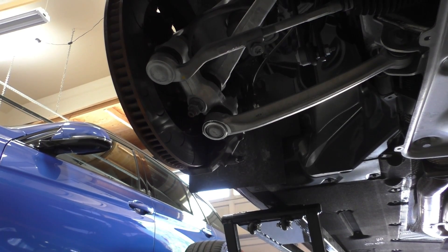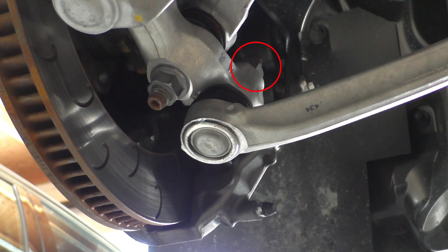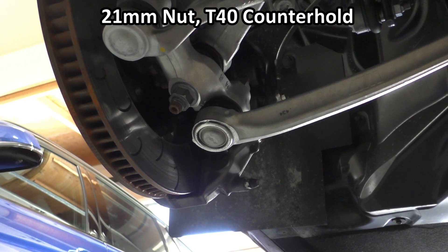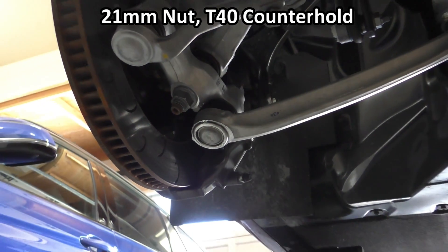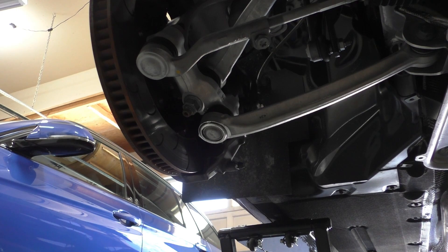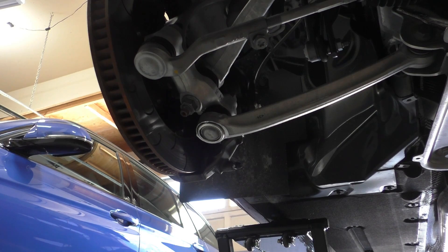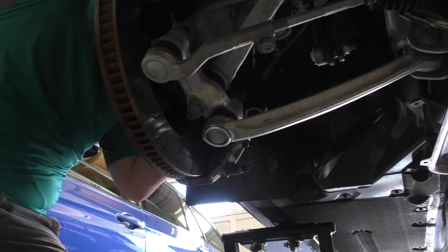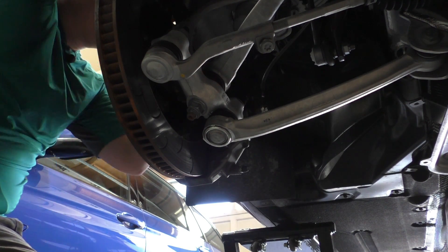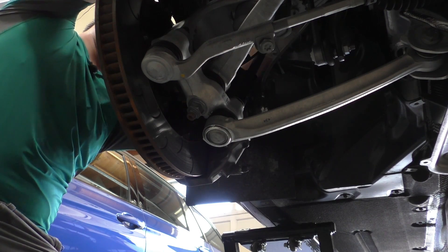Next I want to take off the nut that holds the wishbone or lower control arm to the knuckle. This is a 21mm nut on top, and the post of the ball joint has a T40 counter hold in case you need it. In my experience I've been able to just use an impact and spin the thing off all the way, but there may be a point where you need to counter hold it with a 21mm open-ended wrench and a T40. I'm going to come down from the top with my 21mm socket and impact on an extension — you'll need that for enough working room.